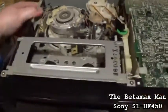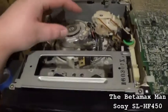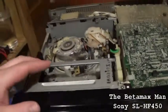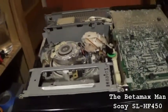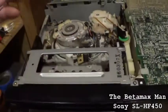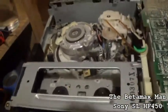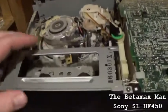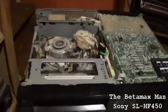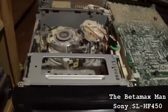This particular set of video heads has the same connector on it. These heads were also used on the SLHF-600 — same connector, same video head drum connector, same head. You can literally take this whole drum assembly out and put it into an SLHF-600 and it will work. I'm pretty sure the connector is even the same.